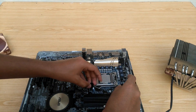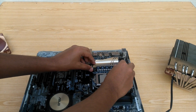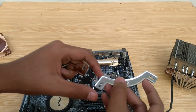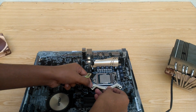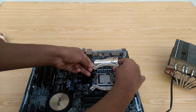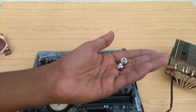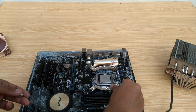Next, you are going to install the risers onto the backplate screws. Once that's done, install the brackets for the CPU cooler. Make sure that the ends are facing outwards and this side is facing upwards. You can orient it so the heat pipes face the PCI slot or the top. Then install the nuts on the four ends of the screws and tighten them up with the L-shaped Phillips screwdriver provided with the CPU cooler.